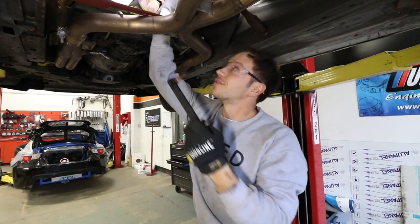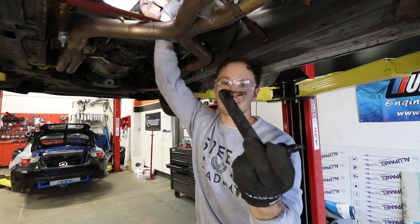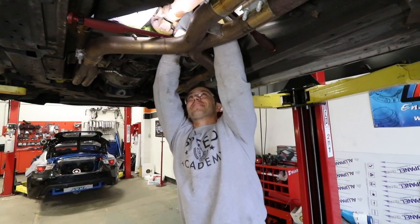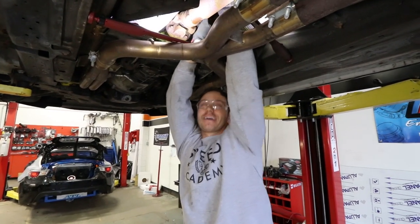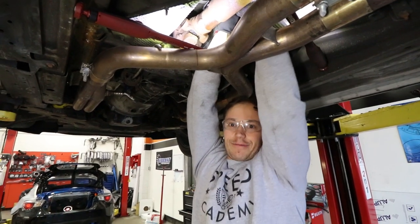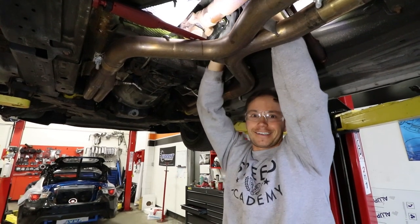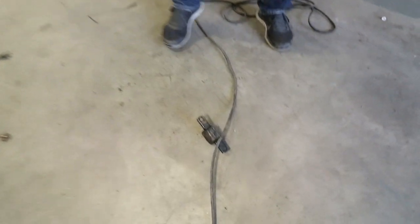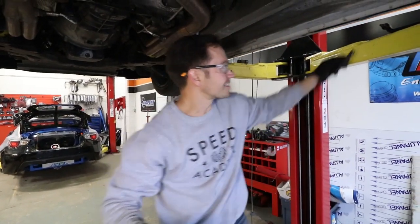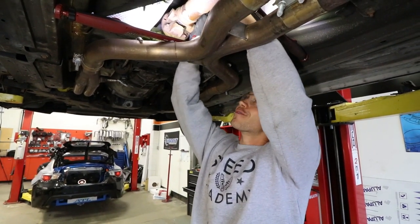It's official — you can't remove the shifter here with the arm attachment that runs directly to the transmission linkage. I feel like you've got to remove this rear mount, which is just a rubber mount, but it's causing me a whole lot of grief. I'm going to pull that one off as well. So that's that rear mount — I'll show you how this all works once I get this thing out of here. Now we've got some room to work with.